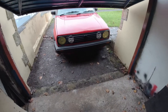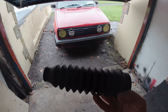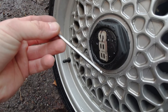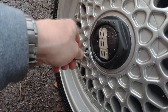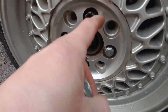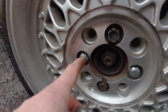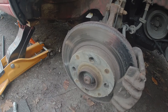What's going on everybody, welcome to my channel. I'm Roman. In this video I'm going to replace the steering gaiter on my old wagon called Mark 2. We'll need a key tool first. I'm going to loosen these bolts - they are 17 mil - and we do have one security bolt here, so I do have a special key for it. The wheel is off the car.